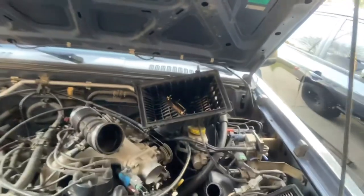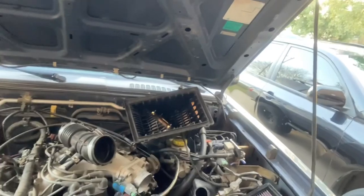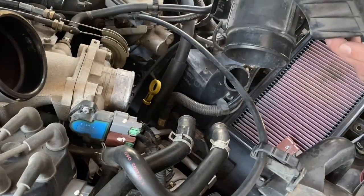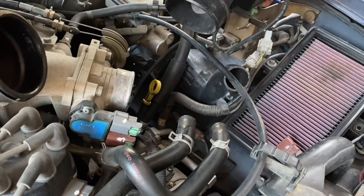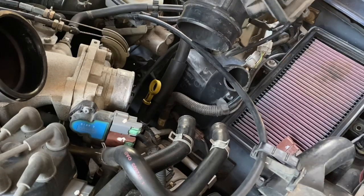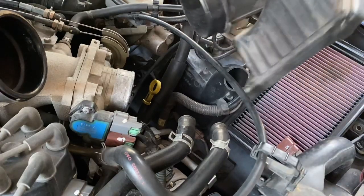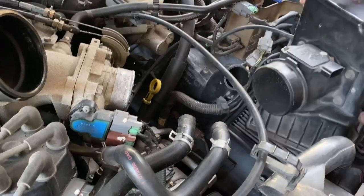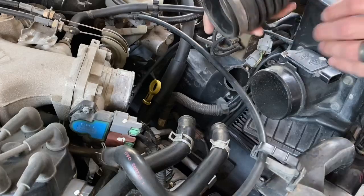So let's put it all back together. I ended up taking the top of the air box off — I'll show you how to put all that back on. If you take your air box off, make sure that you remember to reconnect that vacuum hose. I've got some debris on my little screen — no problem. Reseat that. Actually, I'm going to go ahead and put this on first because it's just easier.